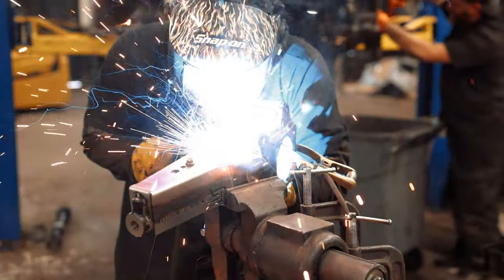After the cotter pin is on, we're going to put on the brake assembly — cotter pin for the CV and then the blue protection nut over that. Put the rotor on and the caliper on after that. Then put the wheel speed sensor and ABS lines in. On the factory spindle location, route and bolt the ABS line to the spindle the same way it was routed before.